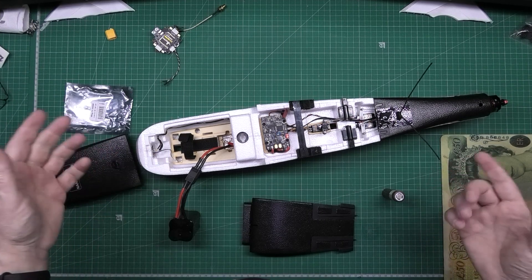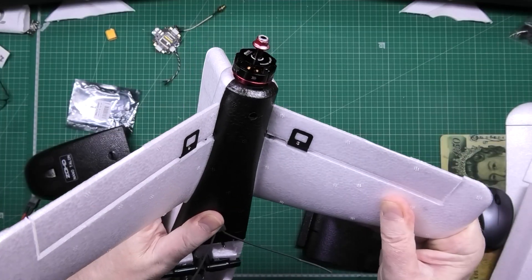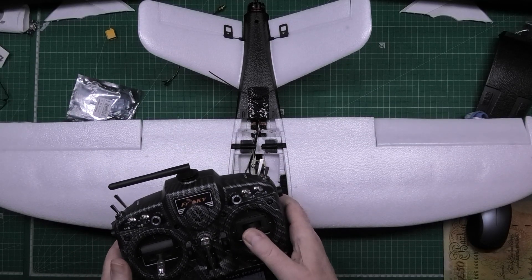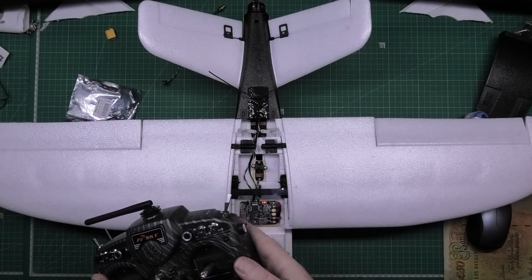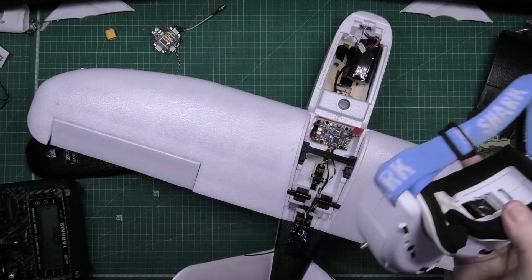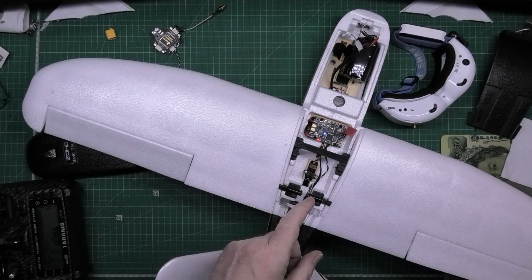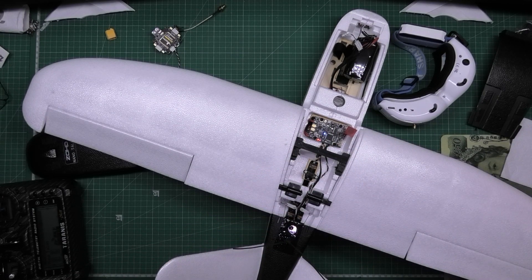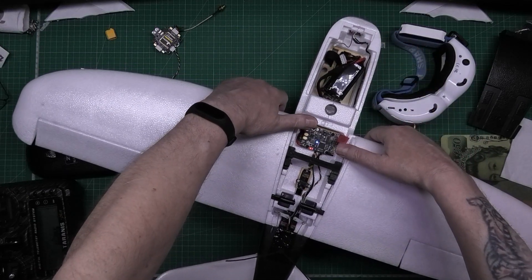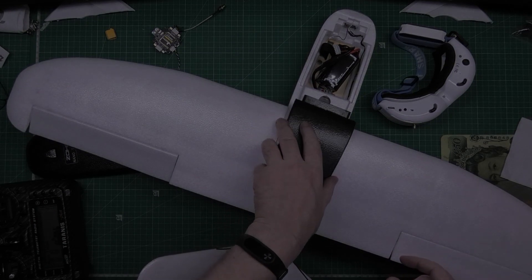I'll put the wings on. Radio control — left/right working, up/down working, left and right rudder working. I can't get throttle yet because I haven't calibrated the compass and everything else. So there you go — in the next video, when I've figured out the CG, I've still got to put the prop on — a three-blade prop — and then get the CG right. It's nose heavy at the minute. I could always put the RunCam on top there to balance it — we'll see.